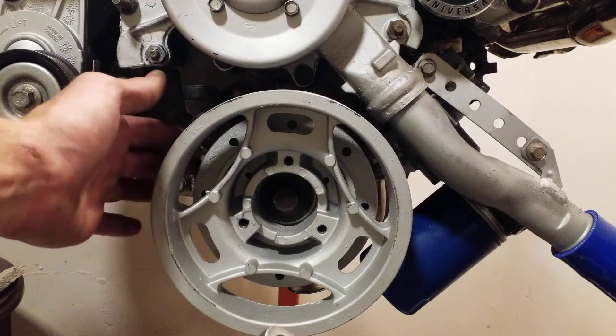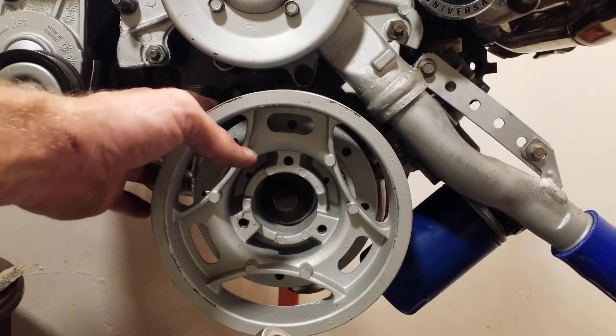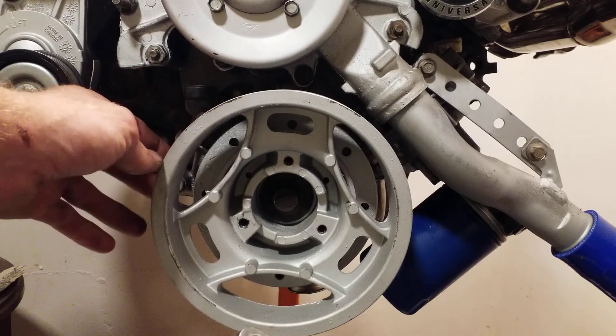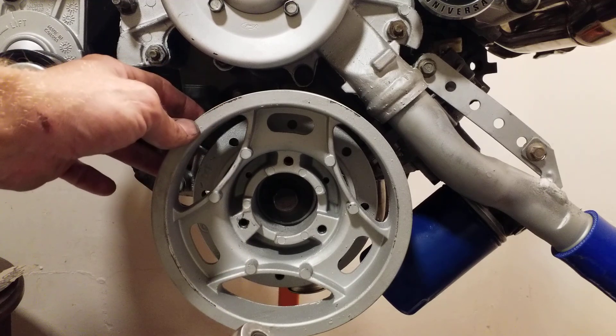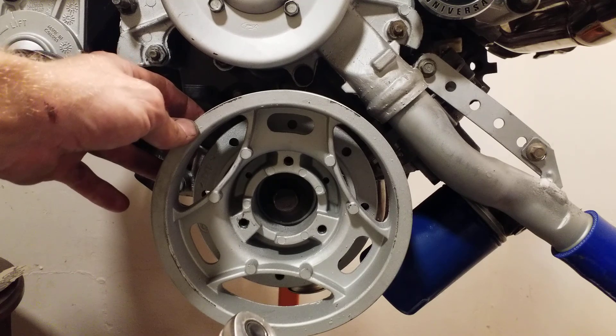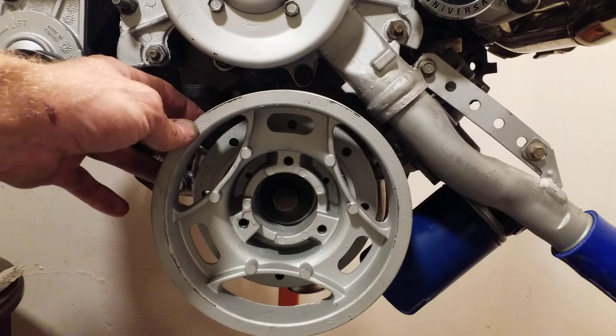When removing the two-piece design, there's a way to remove this front pulley from the crank weight in the back, and that's how you exchange for your Windstar. For your 1994 to 1998, all you're going to need is the front piece from a Windstar — I believe that's going to be the 94 to 95 Windstar minimum. I haven't confirmed it on the 96 to 98 yet, but they're probably on those too.